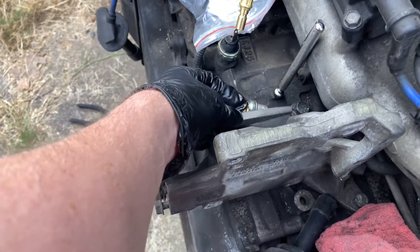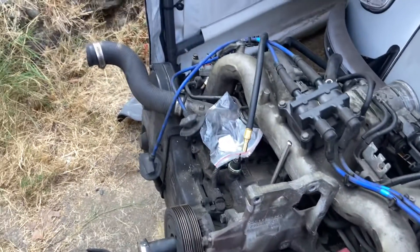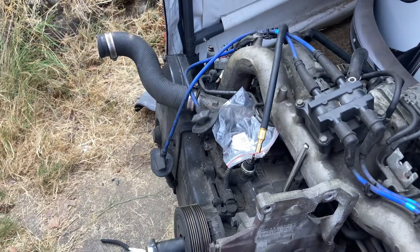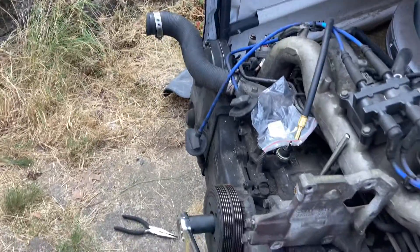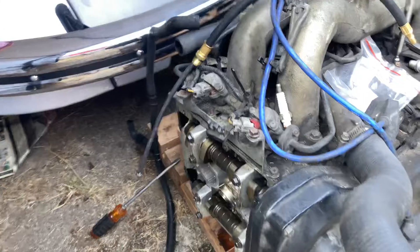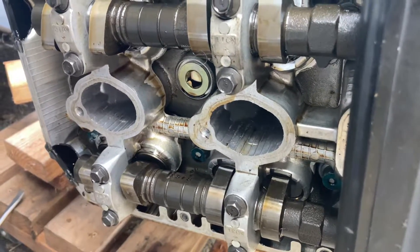The other thing I'm going to do is hose down the inside of the cylinder with WD-40, leave the plugs out, and then crank it before I actually start it. That'll blast out hopefully anything else that's in there — it'll come right back out of the spark plug hole on top of the cylinder head.